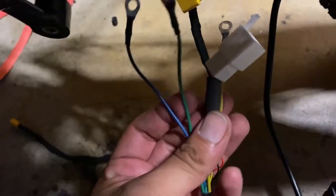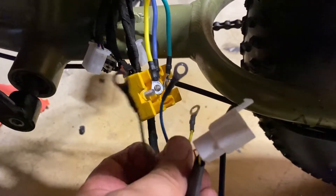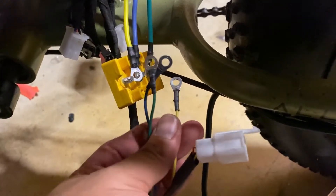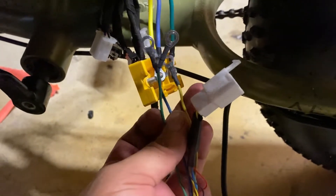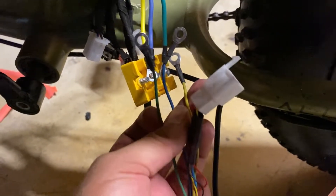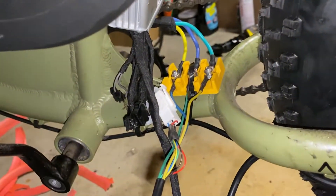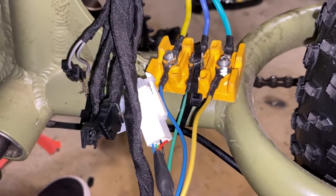Going down the road I'll shorten this. I discovered that the phase wires don't match with the phase wires on the controller with regards to gauge and the color scheme, so the wheel spun backwards the first time I tested it. You're gonna have to figure out, if you pick up the same kit, whether the wiring guide is the same. Got the controller somewhat mounted, the phase wires in the junction box and zip tied down.